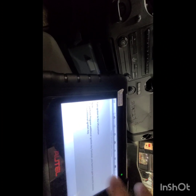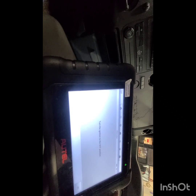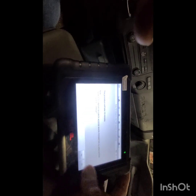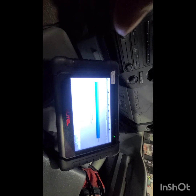Right here, ignition — it will tell you ignition must be turned on, and it has to gain control of the security access. This is going to take 10 minutes to gain access. So once you hit yes, there you go — 600 seconds, which you're going to wait, which is 10 minutes. 600 seconds is up. Operation is successful, so we go to the next step. Security access granted. Hit OK.